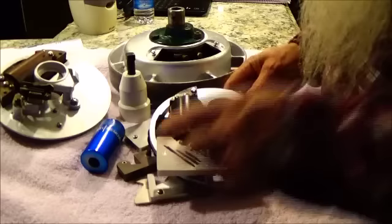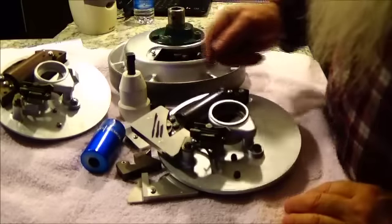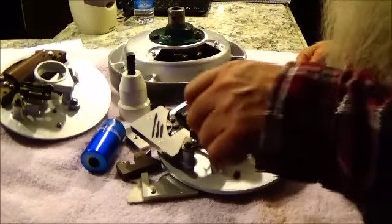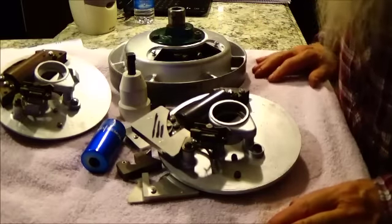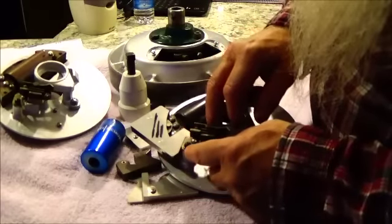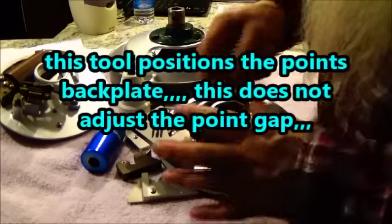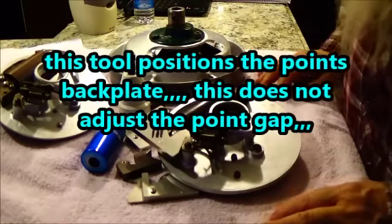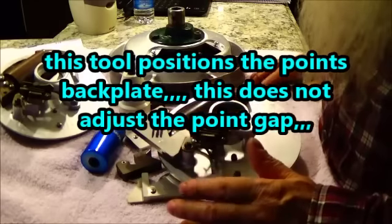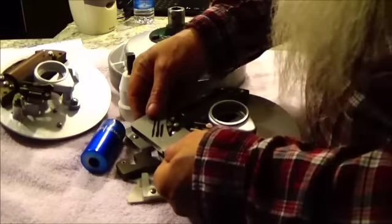The way this thing works - it fits on your coil, on that armature right there coming out of your coil. It fits right down on there. The angle the way that's cut, and then this part right down here is cut so that you loosen up these two screws. You move the bottom of that point plate around to where it fits right in that gap in that tool, then you tighten it up. As long as you don't move that, your points will be adjusted. Once you put that in position you don't move it no more. If the engine don't run, blame it on something else.